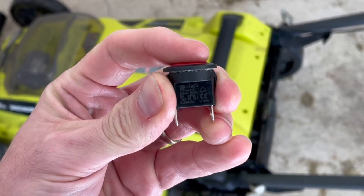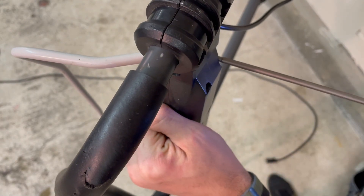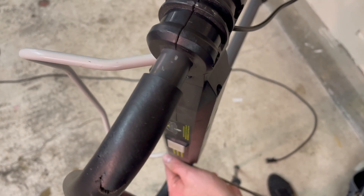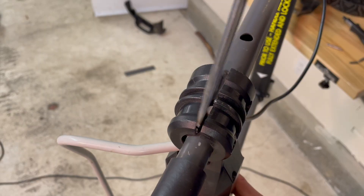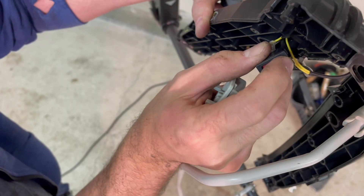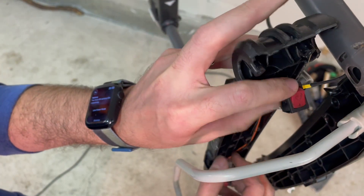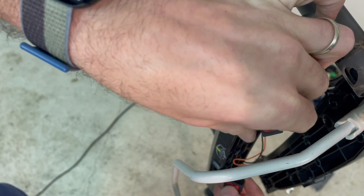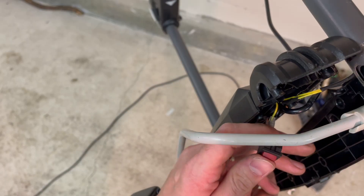Funny story about this one — I'll tell you that in a bit. My multimeter said that one was working fine, so time to check the others up at the top of the handle that are prone to issues — one for the safety bar pull and one for the button. Turns out that holding the power button and then pulling the handle holding that actuator switch is the winning combination. So we have a motor that spins for the first time in a few years.